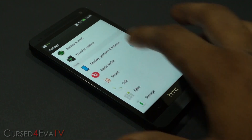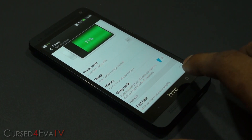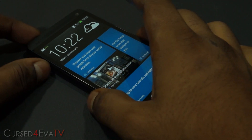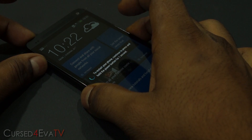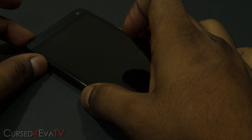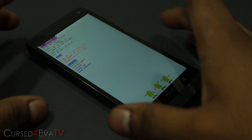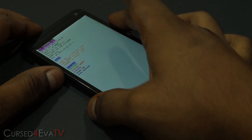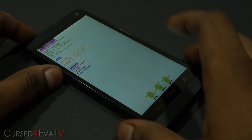What we do right now is first go into Settings > Power and make sure that Fastboot is unchecked. Once you've made sure it's unchecked, hold the power and volume down buttons at the same time. You might end up taking a screenshot but just continue holding it. We are now in bootloader mode. The volume keys act as navigation and the power button acts for selection, so scroll down, select Recovery, and hit the power button.